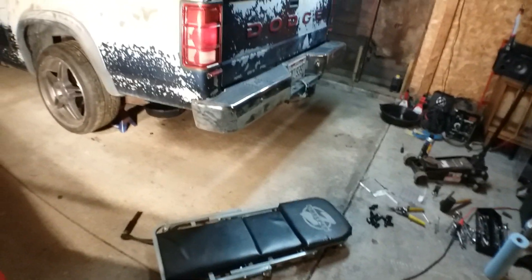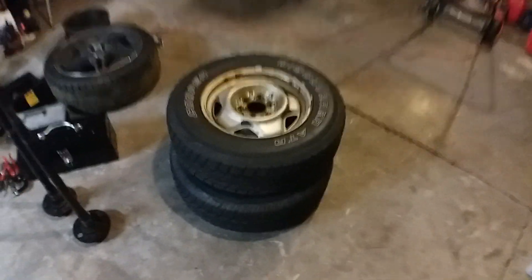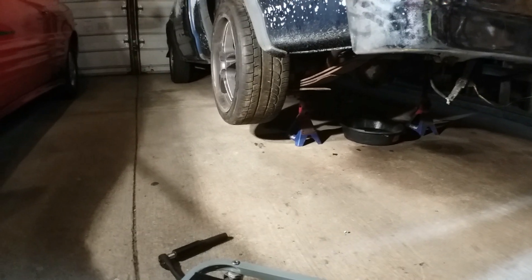I'll get these as tight as I can with the three-eighths, because that'll help make sure it's seated right — if I go straight to the breaker bar things might not seat correctly. I think that looks pretty good. The lighting's all screwed up in here because these lights are almost too bright and it's not daylight outside yet, but there's a little bit starting to poke through. So in a little bit I'll be able to wheel this thing outside so you guys can see it in the light with the 18s on the back. I'm going to finish getting the other wheel on, torque everything down, clean up, put tools away.